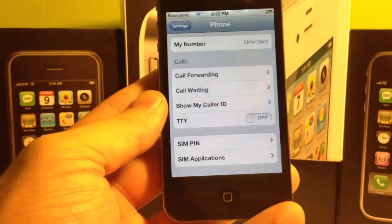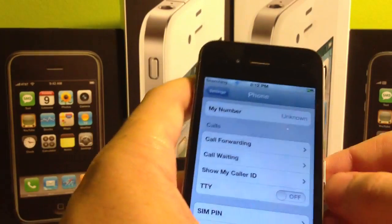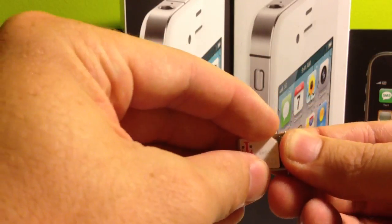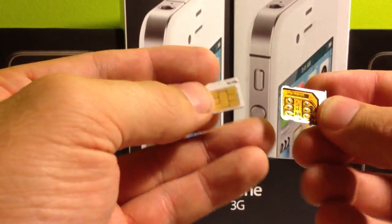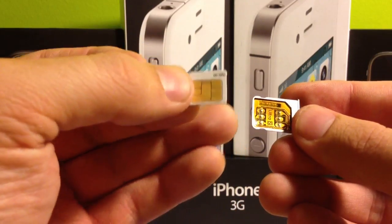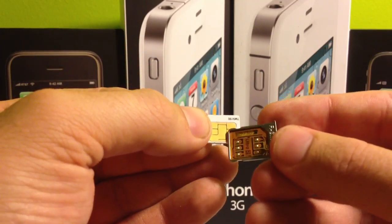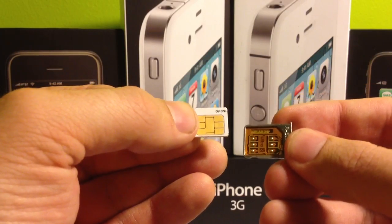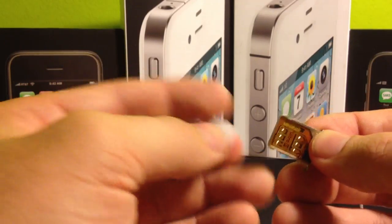But if you can't get that to work, there's a couple of other things to look at. The first thing is you want to pop out your SIM card and take a look at the SIM card itself. Some of you guys may have cut your own SIM cards - you want to look at the SIM card and make sure that the contact points on the SIM card and the RSIM line up with each other. There are six embossed areas on the RSIM itself, and six areas on the SIM card. If those don't line up, it's not going to make a connection and your phone won't actually register there's a SIM card in it.